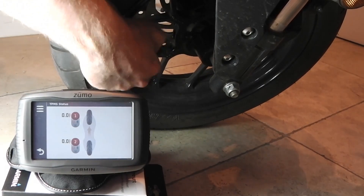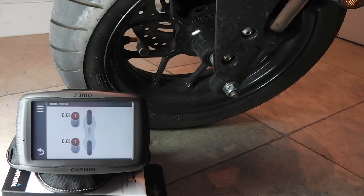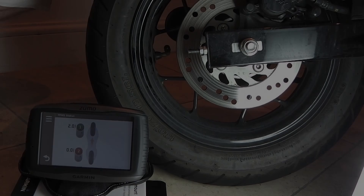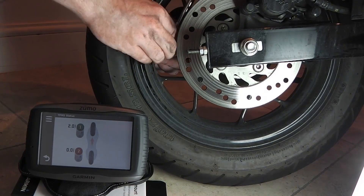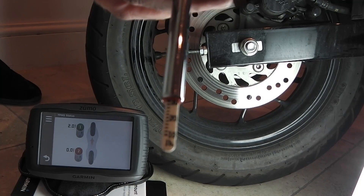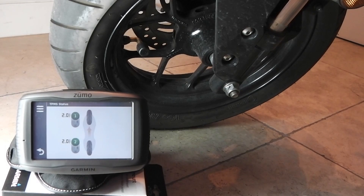I'm going to install the tire pressure monitor sensor and see what that comes up with. When you install these, they are actually motion sensitive, so if you install it and get no reading, give it a tap and it'll come to life. That's now showing 2.0 bar at the front wheel, which is as we expected. Moving to the rear wheel, I remove the cap and do the same drill - the tire pressure gauge reading is showing 30 psi. I install the monitor sensor and that's now showing 2 bar, so we're all good.